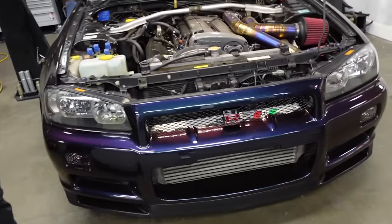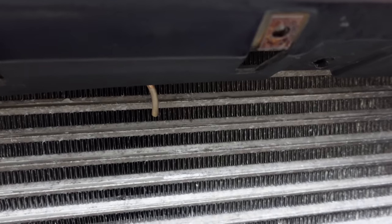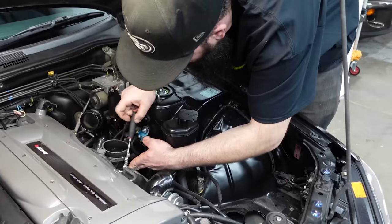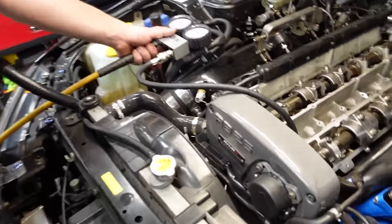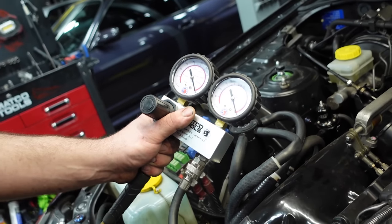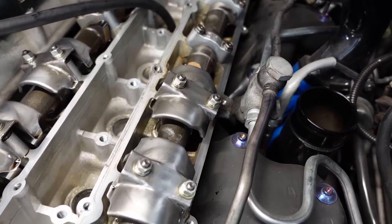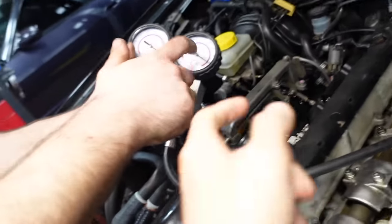You got 40% of a nitrous kit for free — it's just a purge right to the intercooler, apparently to cool it down. Apparently they were a big Fast and Furious fan. Let's get into it. So the first step is we're at TDC on cylinder one. We've injected the cylinder with 100 PSI — you want the same number in and out. If it's 100 in and 90 in the cylinder, that's a 10% loss. So far we're good on cylinder one. We're going to find the bad cylinder — it should be cylinder three.